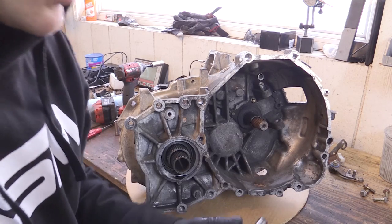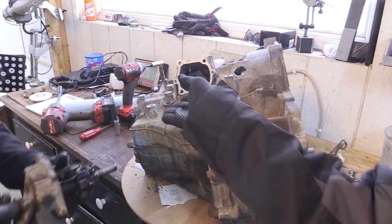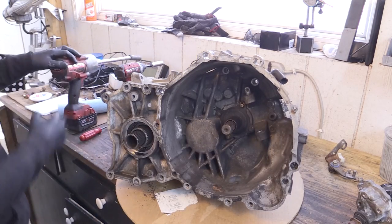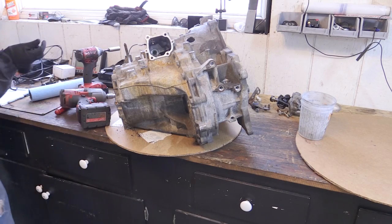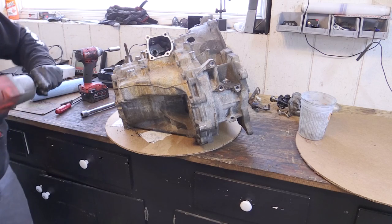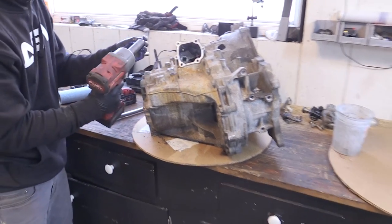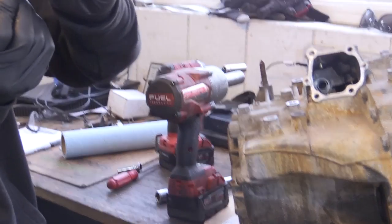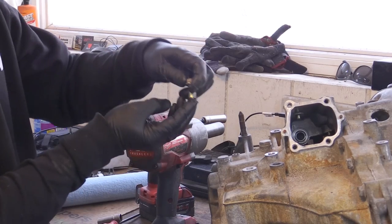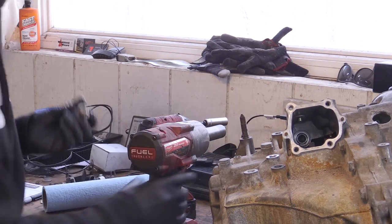When you put it back in, you just have to make sure it's lined up, then slide it in. You can see the shift forks right here — this is what it's pushing on. There are just two detents. On a lot of other transmissions, it's a separate bolt followed by a spring followed by a ball, and it all comes apart. Evos are nice — it's just one bolt and the ball is all held together.